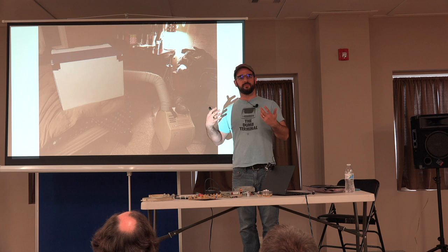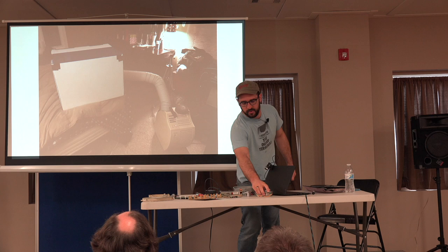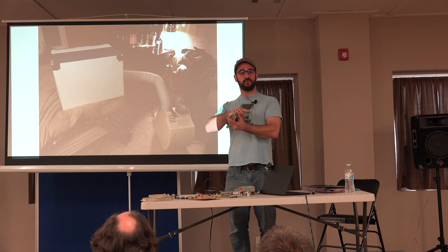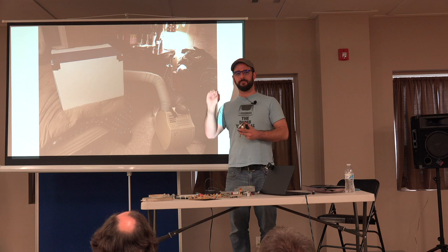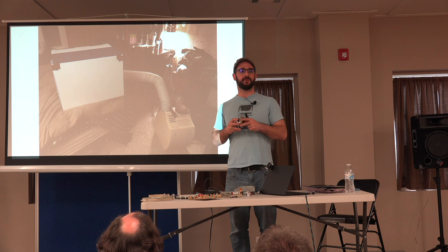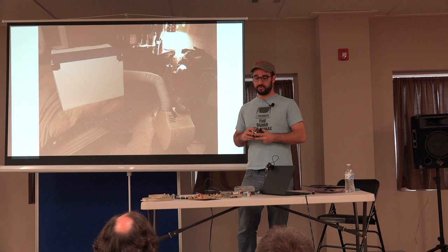And I actually swapped. This motor is not the original one from this disc. This had a good motor on it, and I disassembled both drives inside the clean chamber, switched the parts around, and I found when I started that one up, I didn't get that little ping, ping, ping sound of the dust particles impacting the head like I have on other drives I've taken apart. So it's certainly not perfect, but with a little bit of effort, you can make yourself a clean-ish room to do some disc surgery, and I would highly recommend that.